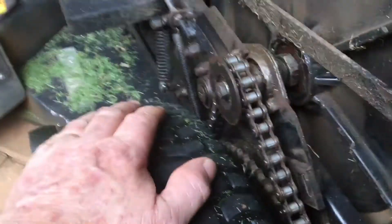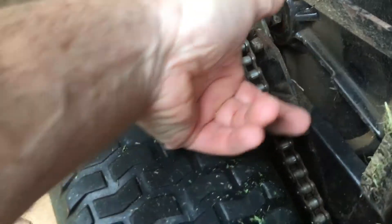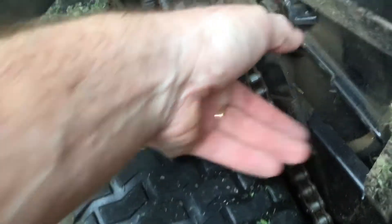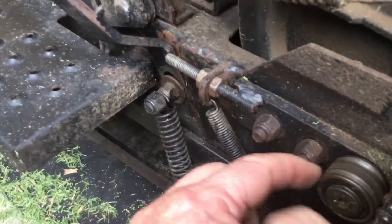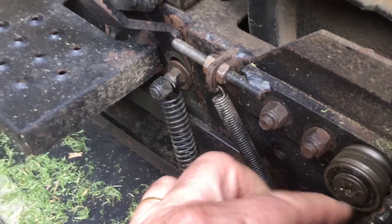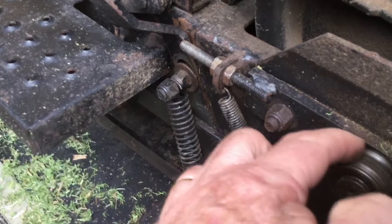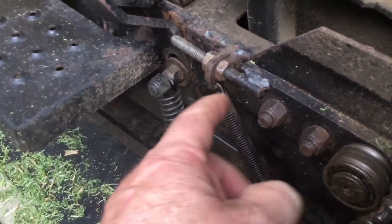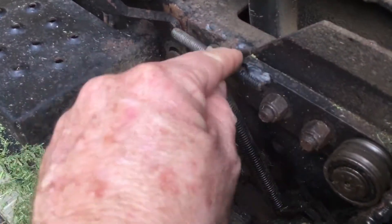Now I've got to give that new chain there a little bit more tension — it's a little bit loose. Let's give it about three mil — it's a brand new chain so it's run in, I'll tighten up. That's just through that adjustment there, that's how simple that is. You just adjust that back. That's twin bearings there. If you want to replace that, Allen key out with that, new ones in, they run on them. All you do is unlock that and that plate can slide — there's your adjustment.